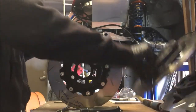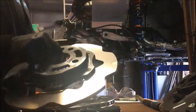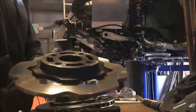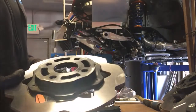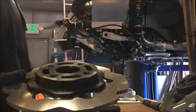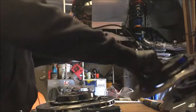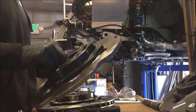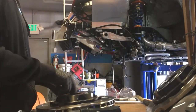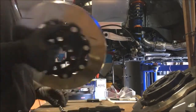In the rear we've got something similar, but it's a solid mount. This is actually also a prototype for the Hyper Miata, but it's a scalloped rotor just to shave weight down. Other than the fancy shape, it's basically a standard V8 Roadster's rear sport size rotor. These save about — we just weighed them — it's about 1.8 pounds per rear rotor, lighter than a standard full circumference rotor.